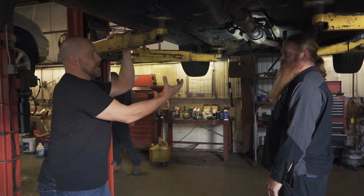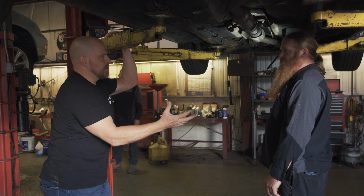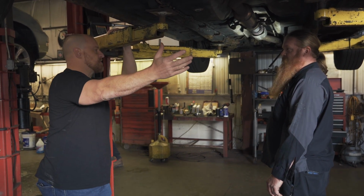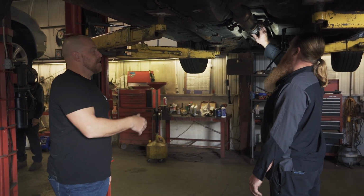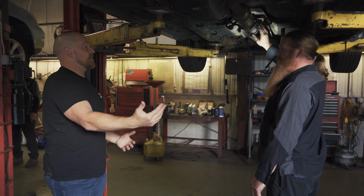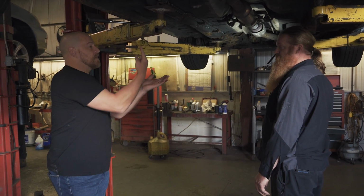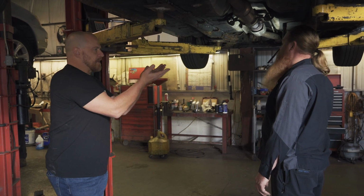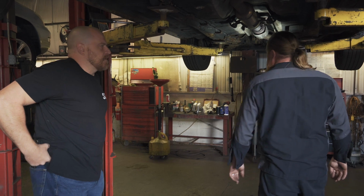Nice. Now the one he showed though was on an F-150, and he said the Expeditions are easier, but he breaks the tab off the one side of the old actuator, leaves the one bolt. It's not ideal, and we would let him know that, this is my friend too. He was comfortable with it because it was his friend's, and the ductwork holds it in place. So one bolt, and then the ductwork holds it in place. So that's an option rather than pulling the whole dash apart.